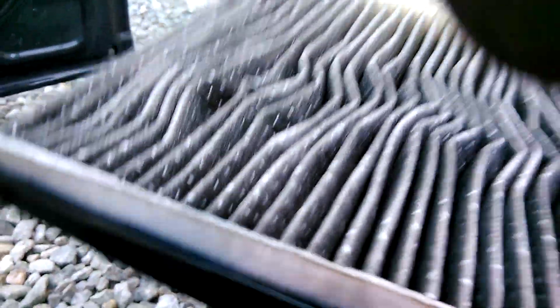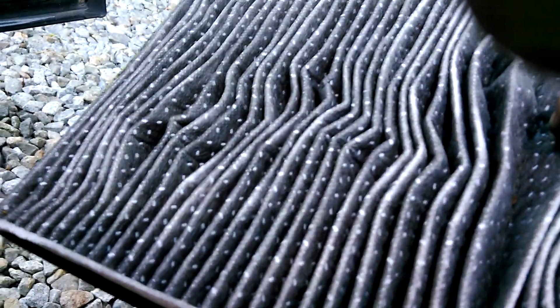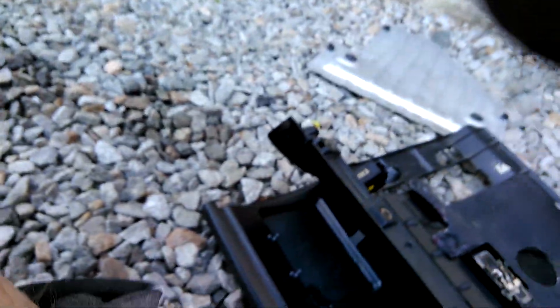The fan is pretty complicated but it is still possible. Clean it once more with clean water to get it completely clean. You can also replace your air filter — I didn't have a new one but used compressed air to clean it. The dark color is normal; it is active charcoal.